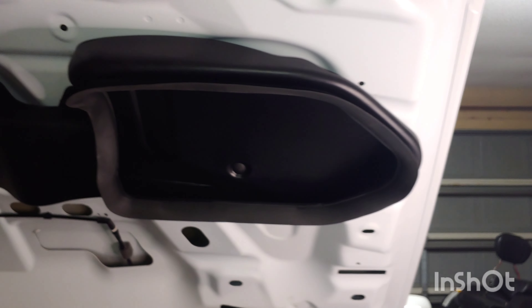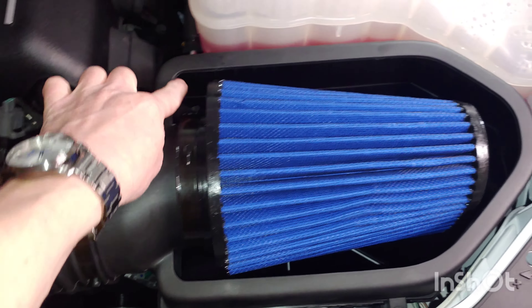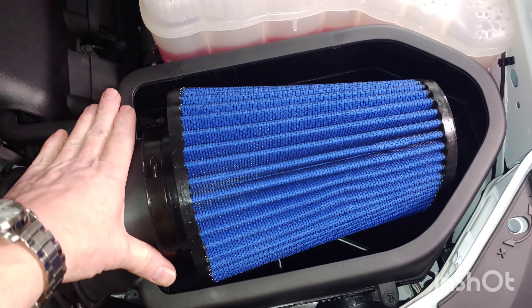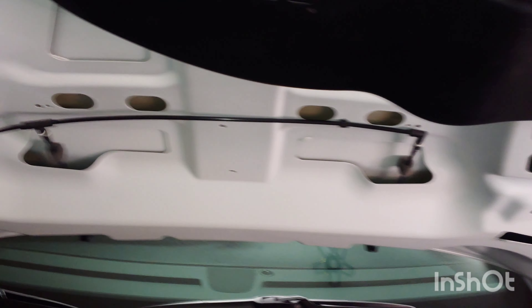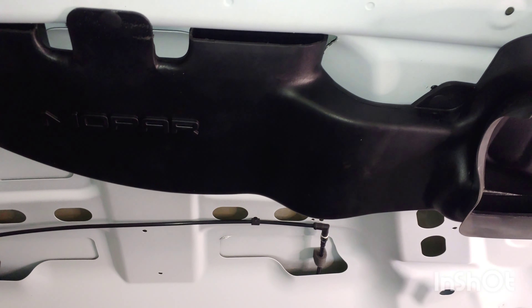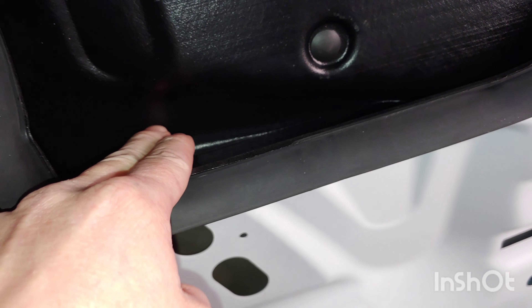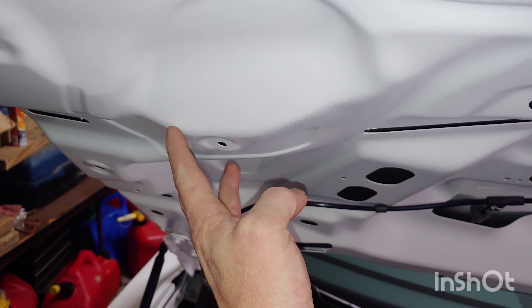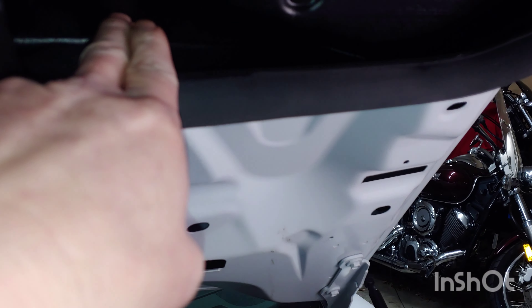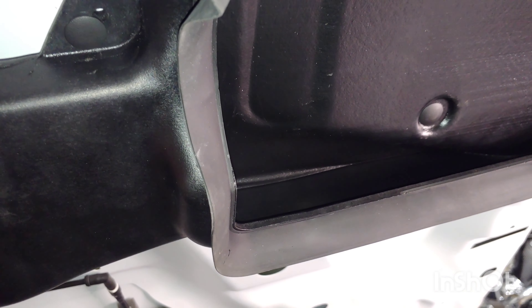Here's what we have underneath. Basically, this is a rubber lip seal, and when the hood is closed it will seal all the way around the housing, providing a good positive seal so no air will leak in from anywhere in the engine compartment — because we're trying to eliminate hot engine compartment air. You'll notice I have my hood silencer removed; I've yet to trim around it and get everything lined up. You'll notice we have this indentation here inside of the snorkel — that bumps into a bulge in the hood. There's a pretty large bulge right there that's not present on the Challengers. We had to cut out a triangle piece back here that coincides with that, then run the deburr on it.